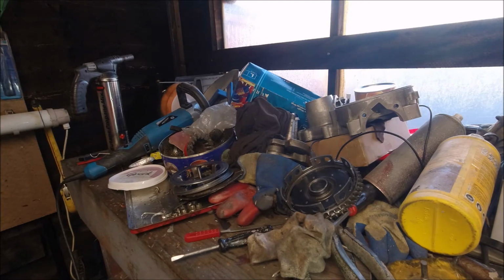Some oil. I'm going to torque that up to, Scooters India recommend 48 and a half to 50 odd. So if I do it to 49, I'm bang in the middle. That should be fine. So I'm going to remove the camera, stick it down in front of the engine, and we'll see about sticking that on then.